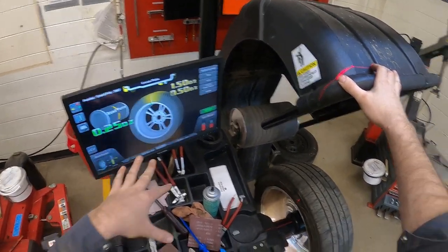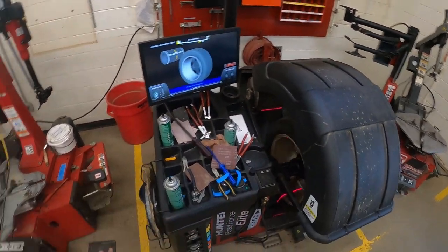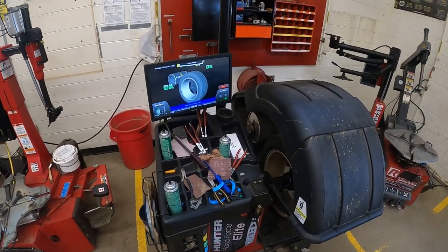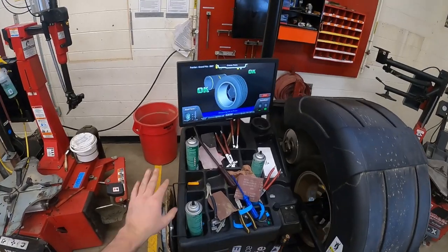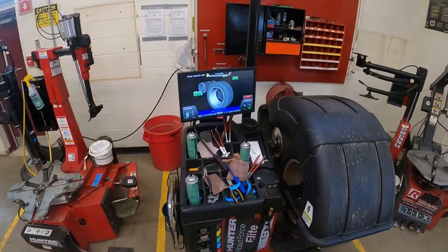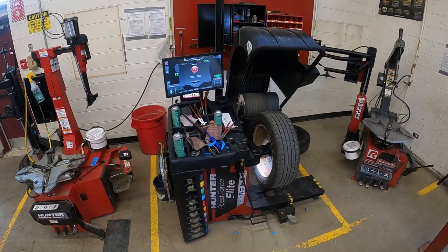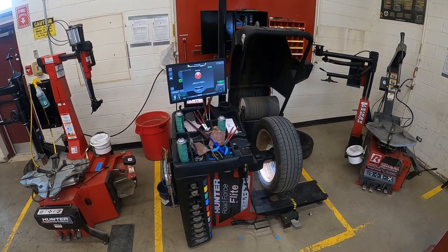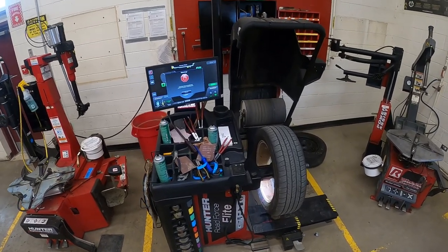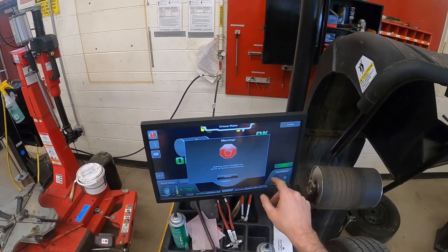It's going to road force again because I had said I was going to optimize and didn't. It's going to ask about the tire pressure since it assumed I'd been over at the tire machine lining up those marks, which I didn't do. I'm expecting to see the same road force reading. You can see it's accepted my weights, so I've balanced this properly. And there's my 18 pounds of road force — it says it exceeds the limits because it thinks I've already fixed it.